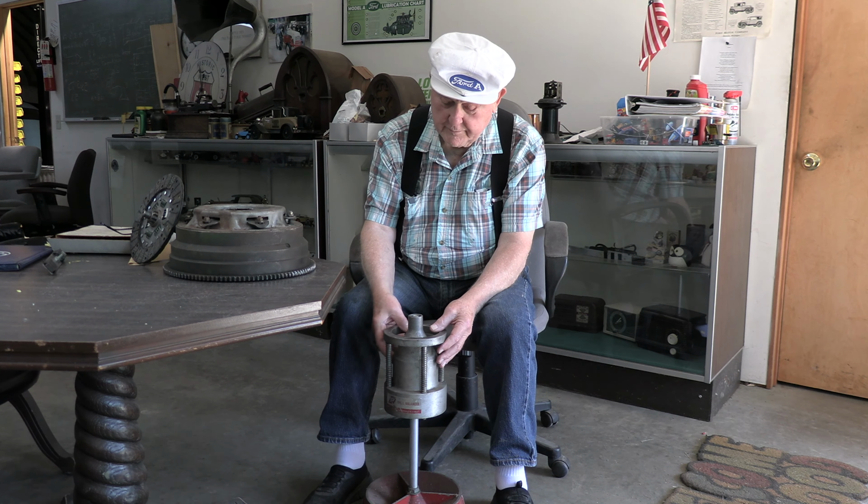The depth in inches is equal to the weight in ounces divided by 0.912. And you could almost say that the depth in inches is equal to the weight in ounces. Now, you have to remember that the drill has a tapered tip, so even though you drill in, say, 1/4 inch, do you measure the 1/4 inch? If you measure it all the way to the tip, you're not getting the full volume. So you have to compensate a little bit.